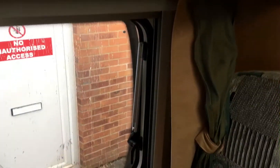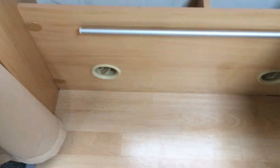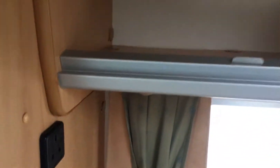It's the full width of the dinette coming down underneath the window — you can see some staining there, right down to the floor. The floor is sound. The high reading is right in that corner, extending down the side of the window. If we look at the roofline, it obviously extends into the timbers there, because this light fitting here is rusty.